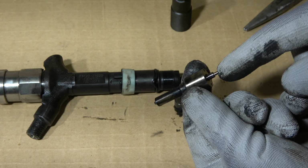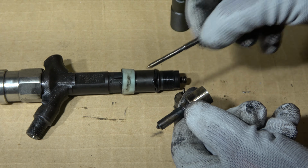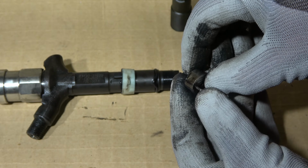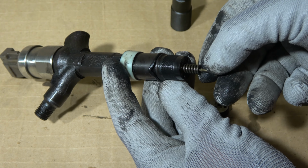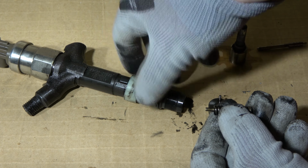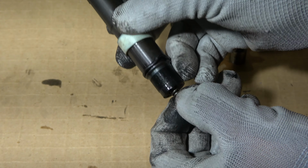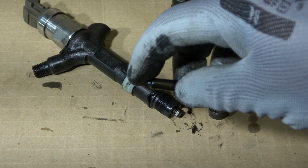And now it's open, and when it goes in here, now this injector's head is closed. And now I take that needle away. Then we can also look at this part, because there are two movable locking pins, and in here we have this magnetic, this electric spring and bolt that moves in here when we have electricity. This electricity comes in these connectors in here, and it moves this part up and down in this way. And then in the same position, my needle moves and opens and closes this fuel injector, this most important nose.